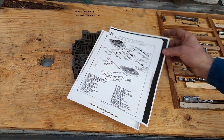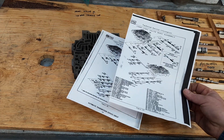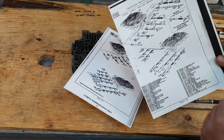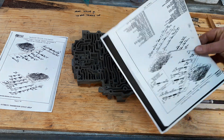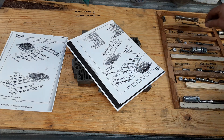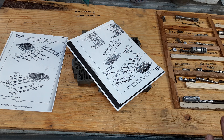Another thing I like to do is take my valve body breakdown page from my ATSG manual and make a photocopy of it, so I'm not handling my book with goop on my fingers — because you're going to have assembly goo and transmission fluid on your hands. Make a photocopy so you don't get fingerprints on your book. Before I start reassembling this, I orient my ATSG page in the same orientation as my valve train, and I double-check that every valve, every spring, everything is in the correct order. I go over and over it until I'm satisfied that nothing is amiss.